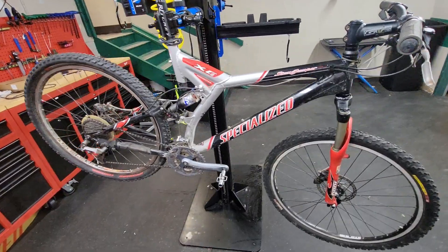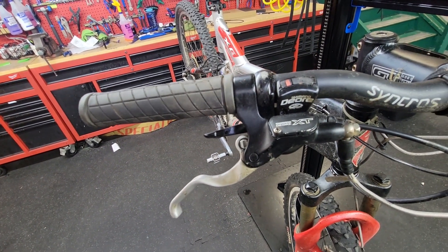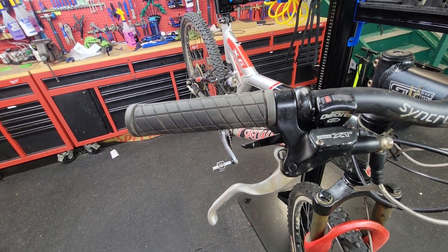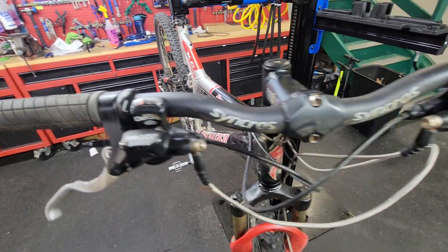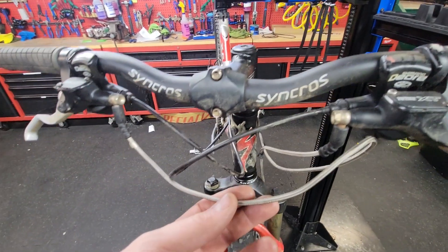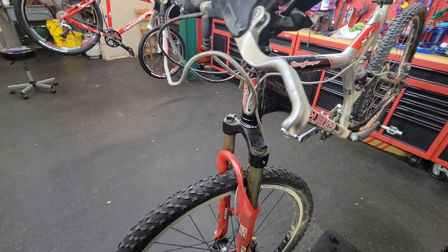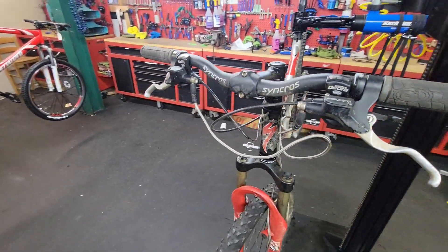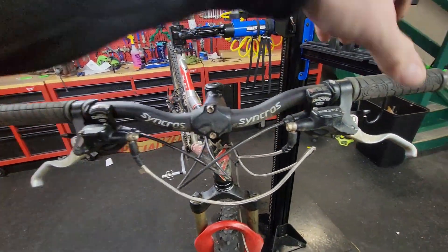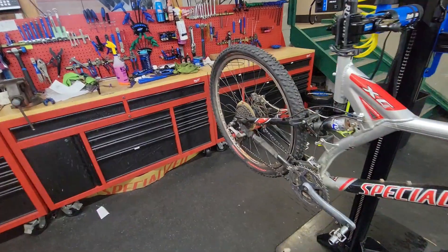First thing that I'm a little concerned with is the brakes. I believe these are the first, if not one of the first generations of Shimano Deore XT hydraulic brakes. These are quite difficult to work on. I have bled them before, but parts for these are going to be pretty darn hard to find. Reliability on a brake like this is going to be pretty bad nowadays. You're talking older brake lines, reservoirs that have a seal on the top that may or may not be good. Personally, if I were going to fix this bike up for myself, especially if I was going to actually trail ride on it, I'd be replacing these brakes. Even if I can get them to bleed up and work just fine — this one's totally flat right now, this one has a little bit of pressure but it's super spongy — I wouldn't really trust them for the long haul.